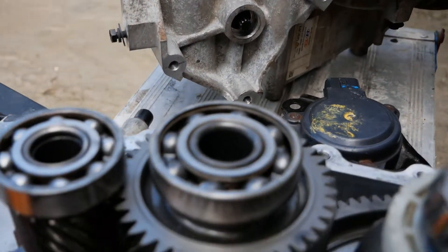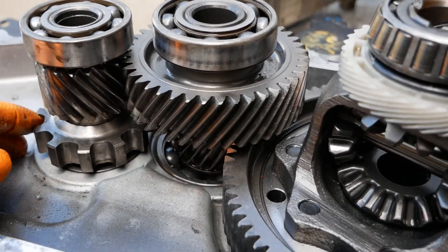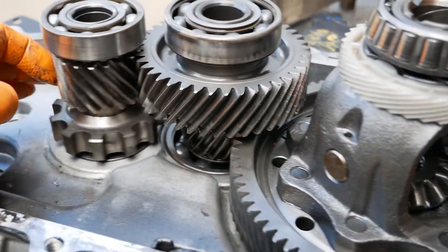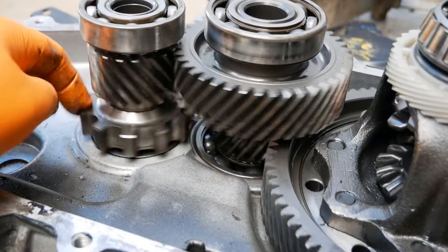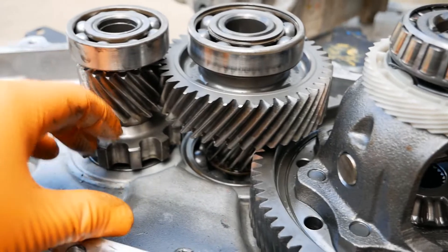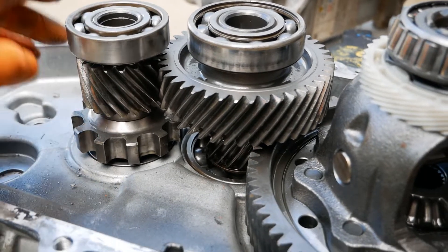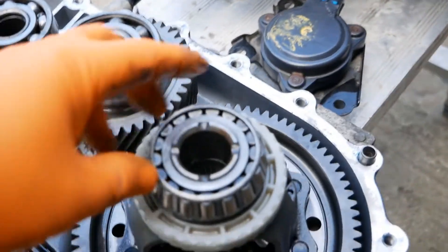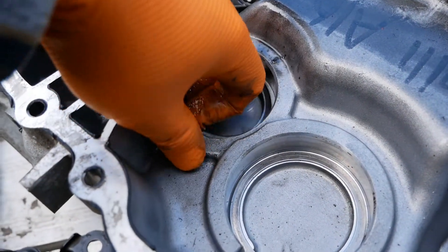As you can see, very simple devices. With electric vehicles there are far fewer mechanical parts and far fewer wearable parts, and even inside the gearboxes there's very little going on — very little to wear. As long as your toothed gears here are up to the speeds put on them, there's really very little mechanical wear. There are no sliding and moving gears like you would get in ICE gearboxes — you've just got your bearings on either end of each shaft.